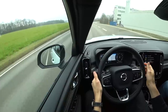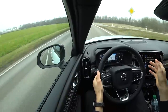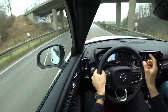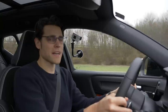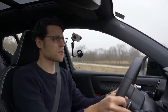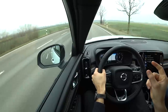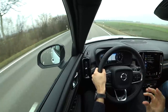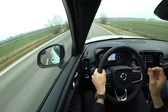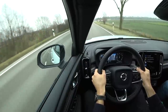It's really keeping the lane, but it's more to help you. I've done that with the XC60 in slower speed traffic. If you're rolling at about 15 kilometers an hour, that's okay, but after a few seconds the car warns you to keep your hands at the steering wheel, which is correct. Pilot Assist works up to 130 km/h; the ACC adaptive cruise control works further. You may have read about Tesla and the Volvo ACC system — it works to keep distance to moving objects, but not to objects standing still, which is rather the task of the autonomous emergency brake at lower speeds. The AEB is standard equipment; ACC and Pilot Assist are optional.